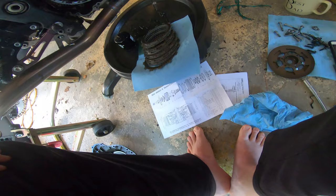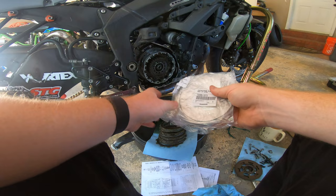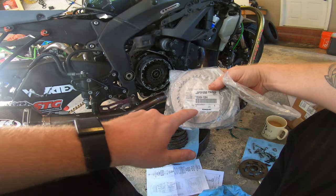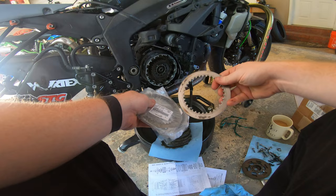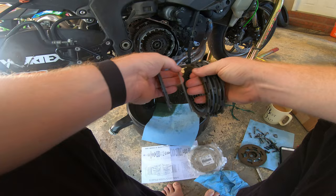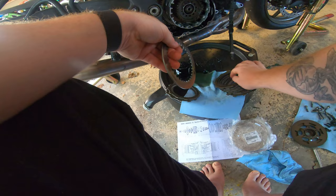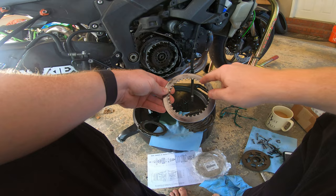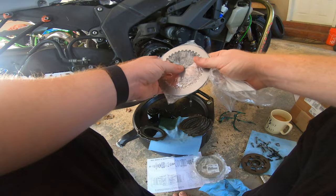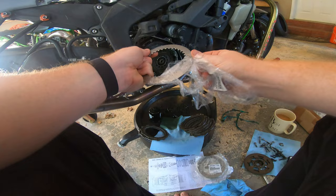These are all the different steel sizes from Kawasaki — clutch plate 2.0, clutch plate 2.3, and clutch plate 2.6. I found an older plate in there during my inspection that has some grooving on it. Knowing where it is in the stack, I can identify it — you can see that circular grooving right there. I don't like that, so I'm going to replace this worn 2.3mm steel with the 2.6mm one, which is still in good condition.